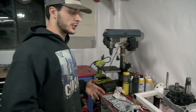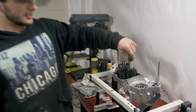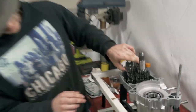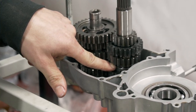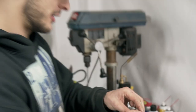You want to let it drop into place — see where it's catching, see what's binding. A friend of mine the first time he did a bottom end put the transmission in and it was catching and binding. The transmission isn't broken — it needs the shift forks to spin freely. Shift forks lift and lower the gears, which is what happens when you're changing gears. Right now without the forks set in place it's binding — turns and stops. That happens with every transmission. Once we get the shift forks in all the gears will be in place and it will spin freely.